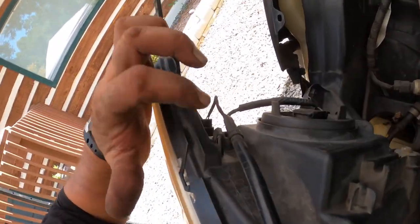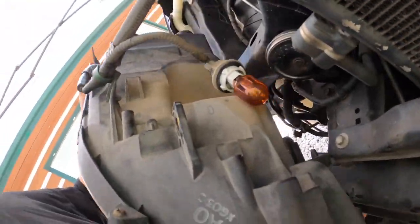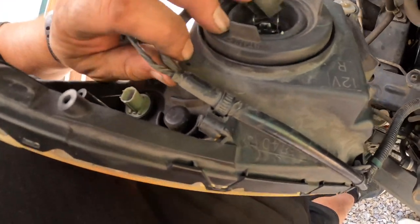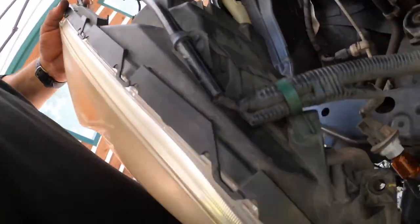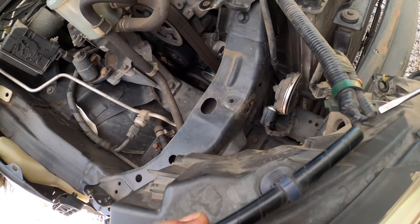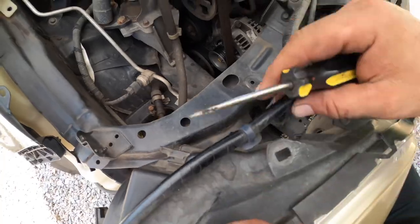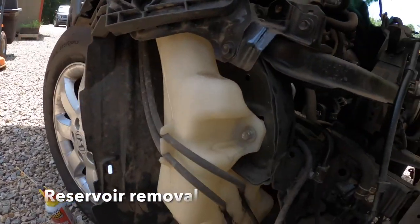The connectors need to come off — that bulb and this bulb right here. This one just unplugs, and this one you push the little tab and it pops right out. Luckily one clicked right off but the other two have to be pried off. Now the headlight can be completely moved out of the way and there is access to the windshield washer reservoir.